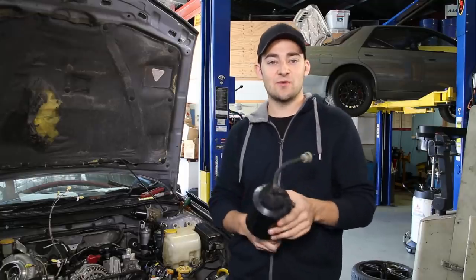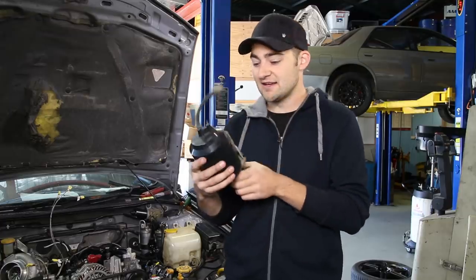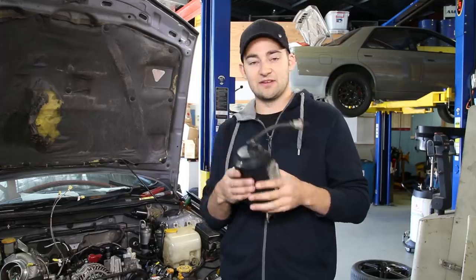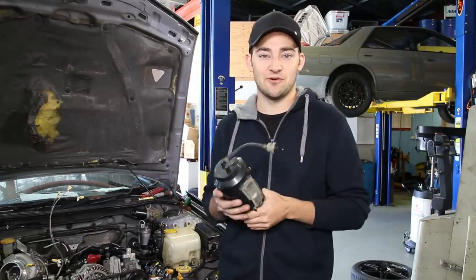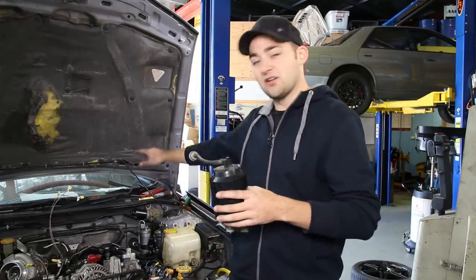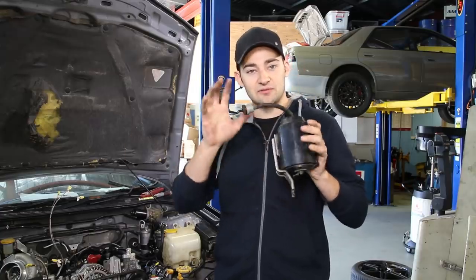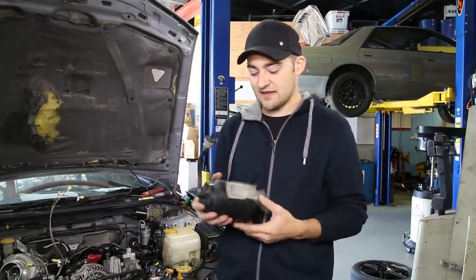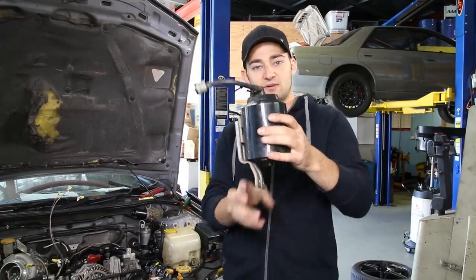Our fuel system is almost done. There's only one missing piece and that is the charcoal canister, which you'll find in almost all cars. Its role is basically to stop fuel vapours venting into the atmosphere, which is a big deal particularly in countries with stringent emission laws - fuel vapour being released is the same as pouring it on the ground. It's bad for the planet. There's a line that runs up from the fuel tank that sucks in the fuel vapours into this, it's stored in the charcoal, and then under the right engine conditions it's burnt back through the engine during cruising and non-critical moments. We're going to install this back in, run the lines to it, and then we've got a properly closed and awesome fuel system.